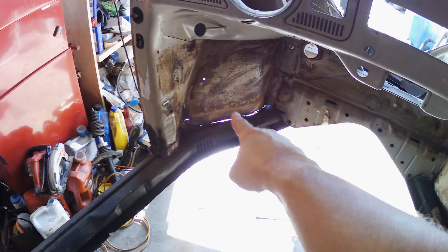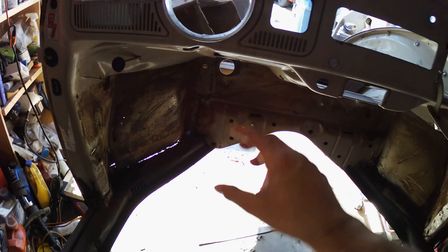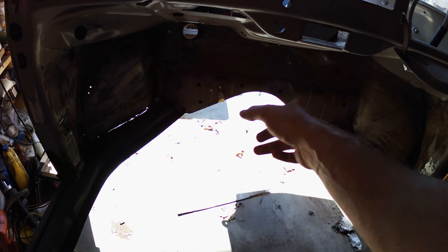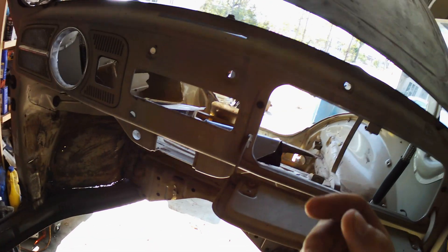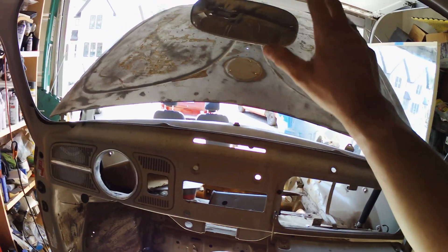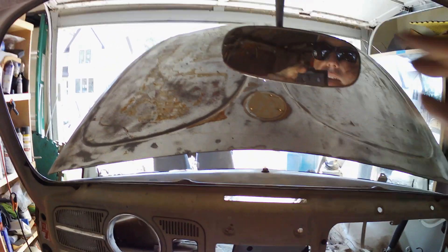Still got a lot of work to do here — a lot of work on this foot area. That firewall is probably going to be modified to be a square section, so I might mount that to the pan: cut that section out, reinforce it. That way it can stay on the pan. If I can do this right, I could still take the body off — that would be really cool. I'm going to get rid of this mirror; there's a door going there, you won't be able to see anything. But they make digital mirrors with cameras, so that'll be a camera-fed mirror going forward.